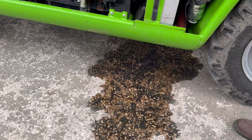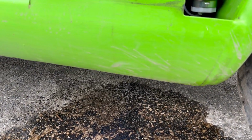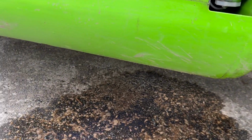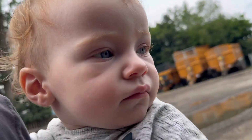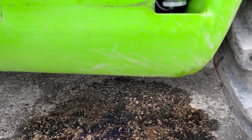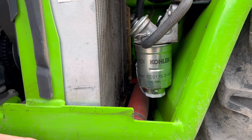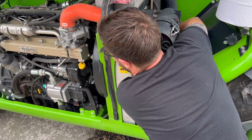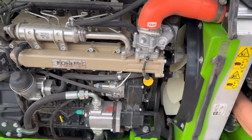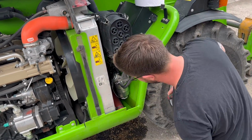Seems to be a little bit of an issue here with this. It's dripping diesel after we were messing with it the other day. Must be something not quite on properly. What do you think, James? I brimmed the tank, so maybe that helped. Have you been dying to use your new snap-on hose clamps? Yeah. Rob says the Jubilee clip's gone, so he's just gonna put a new one on it. It's right behind that filter, which is a bit of a pain.